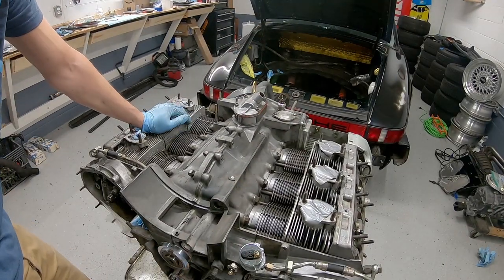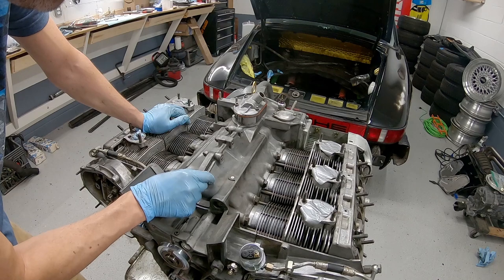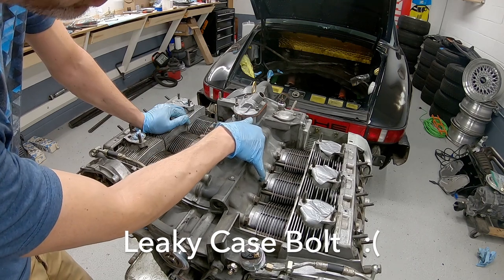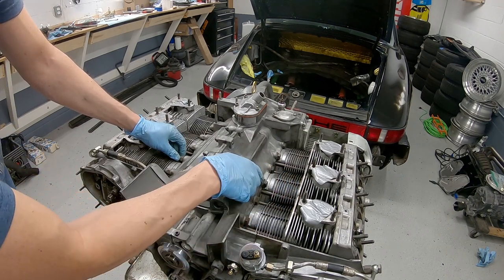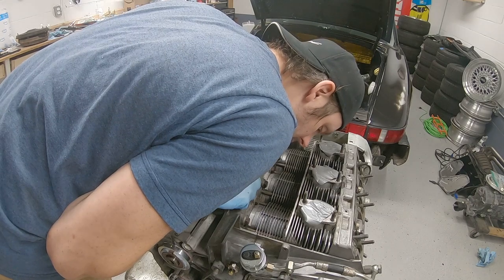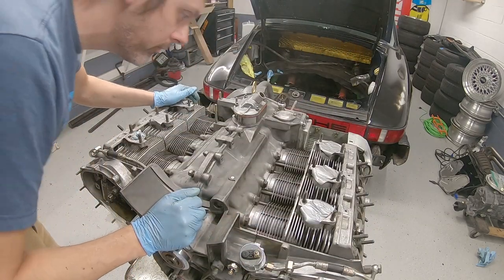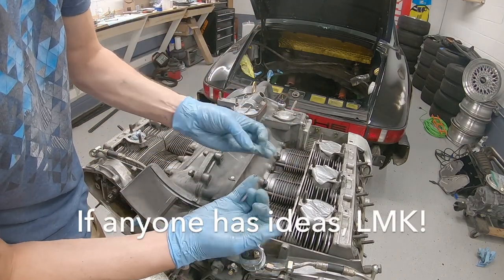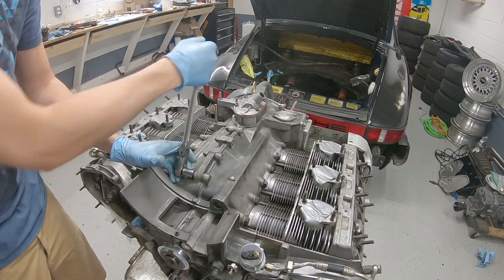One thing I want to do here is tighten this nut to bring the case a little tighter without disturbing it. On this case bolt it's wet - there's an o-ring underneath that washer. I'm going to try to loosen it and pull it out a little bit to put a new o-ring with some silicone behind it. Actually, that washer might be captured so I may not be able to get to it. It's really nasty looking compared to all the other ones - it looks like someone forgot to tighten it.